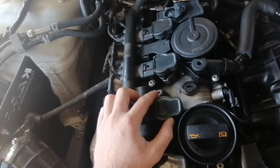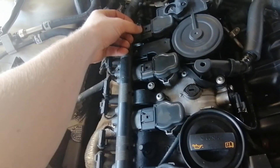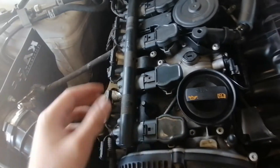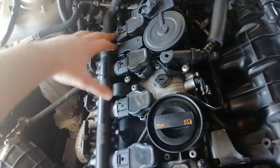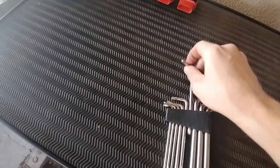There's one bolt — if I'm not mistaken it's a T30 — and there are clips at the back that you just click backwards. This clip over here did break; they do tend to break so be very careful. I've got one broken but the other three are still fine. Then you move everything backwards and lift them straight out. Let's grab the T30.